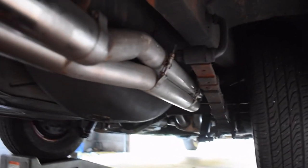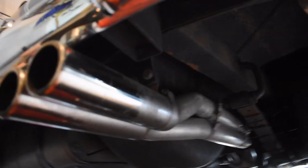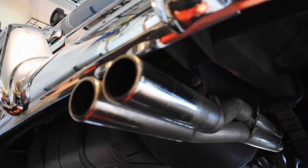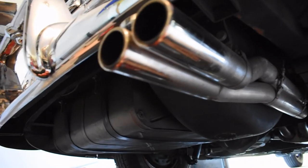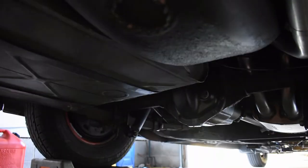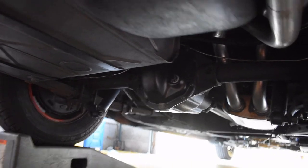Now we're at the back of the car. There's one more rubber hanger here, and then these nice chrome exhaust tips and they are done. I have seen a couple of people who have jumped over to the other side of the car to have dual exhaust where one pipe is on either end of the bumper. If you're going to do that, the place to do it would be after the rear axle, in between the diff and the fuel tank, but I kind of like them on this side — I think it's simpler.